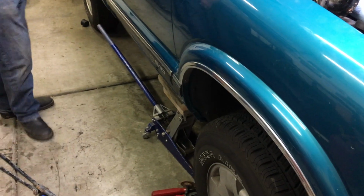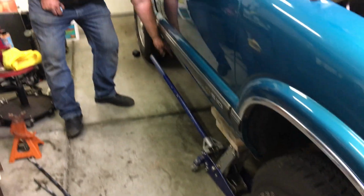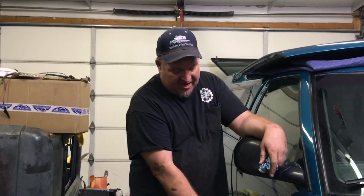And there's another set right here on the back of the body, right by the door split. You don't need to remove those all the way. Loosen them down, but leave them in there. And then you can jack this body up. You only need like 4 inches. So it's tight, and it's going to be quite interesting putting this back in. We're probably going to lift the body up even a little bit more to get that angle, to get it to go in on that shaft.